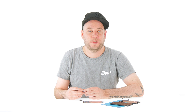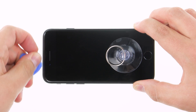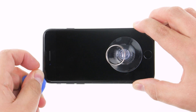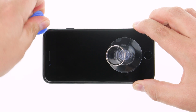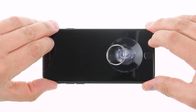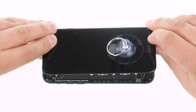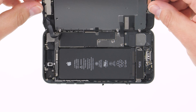During repairs like replacing the battery, be very careful not to stretch or tear the flexible flat cables. When you lift the display, don't lift it too far at the bottom where the home button is. The display is hooked and glued on at the top, so it's best if you carefully pry it out with a pick and detach the glue before you lift the display a little while tilting it steadily. Don't tilt it more than 180 degrees and set the display down carefully.